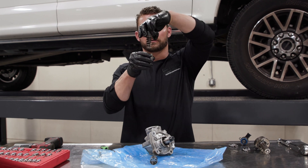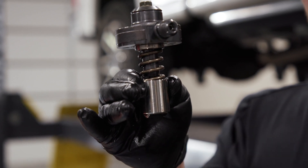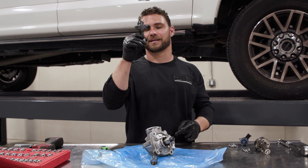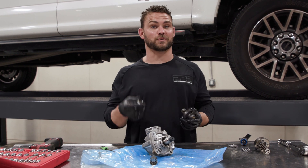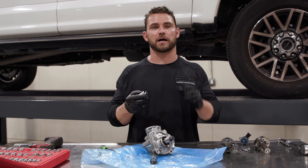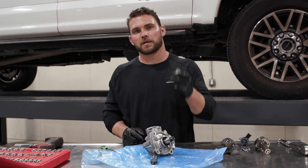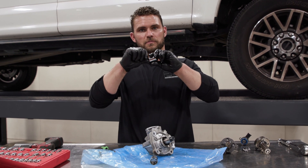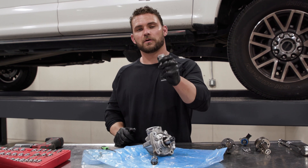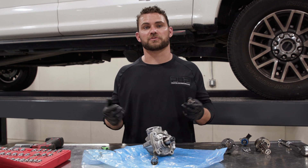When we put the piston and the lifter together, we create high pressure fuel. The camshaft comes up, pushes up on the spring, and high pressure fuel comes out — that's exactly how your diesel engine runs. Now, this is lubricated by low pressure fuel. Just one time you starve the pump for fuel and it runs dry — you get metal on metal. Non-lubricating materials together can cause the pump to fail, and when it does, it eats straight into the camshaft. That's a failed CP4 pump.